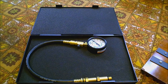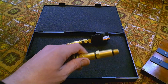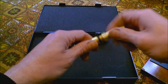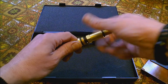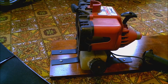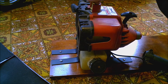What I have here is a compression tester I ordered a while back — it's a four-piece kit and all of it comes apart. You have different adapters for different size spark plug holes. I match up which size fits: this one seems a bit long — you don't want it hitting the top of your piston, so we'll take that one off. This one's clearly too big and way too long, so off it goes. That one seems to be the perfect size, so we'll install that. Just make sure you don't cross-thread it — there are O-rings, so just tighten it up by hand and that'll be fine.